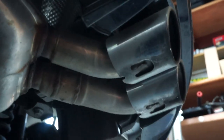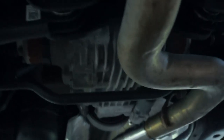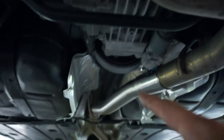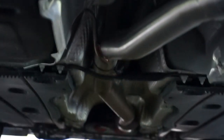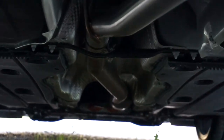You've got your main muffler. Well, you've got Golf R, right? Quad tip exhaust, which is actually a real exhaust. You can see here that it's welded on tips to quad pipe into one muffler, singular pipe coming off. Right there is where I made the cut, and then the new shiny bit is the new resonator delete pipe. And that goes down, and then I installed that hanger up there. And then we put the factory clamp back on, back in its original position.